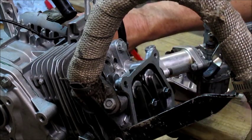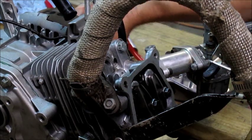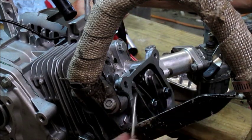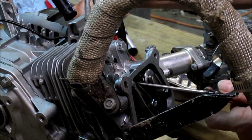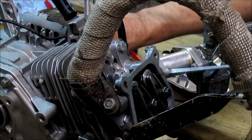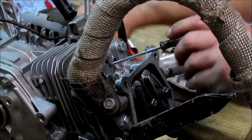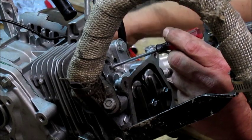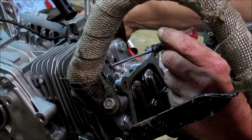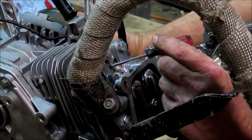Now it's going back down because the fuel has ignited, pushing the piston back down. Then the piston is coming back up forcing the exhaust gases through the open valve — you can tell because the rocker is pushed down and the valve is open. Now it's going back into the intake stroke, sucking air and fuel back in. This is when we want to put the screwdriver in to find a rough approximation of top dead center.